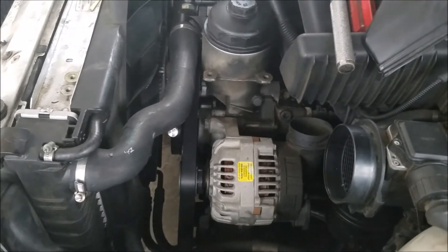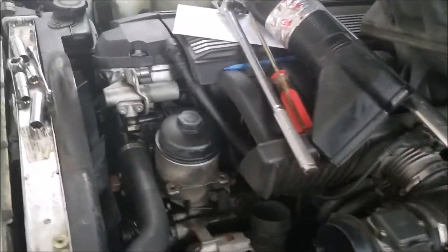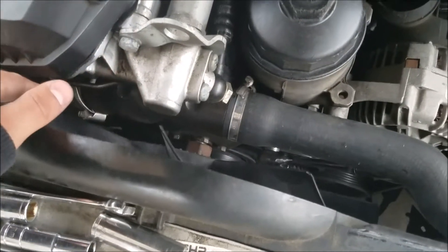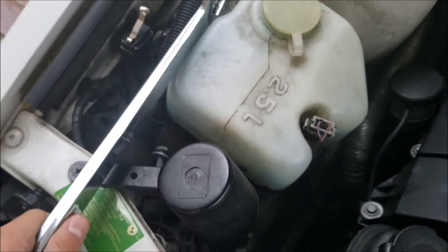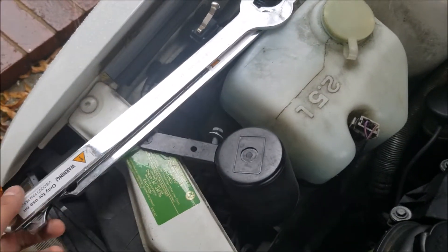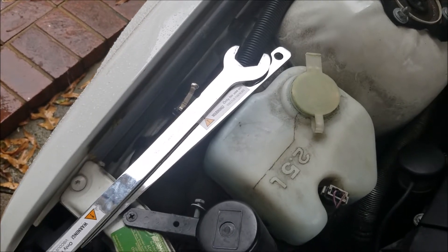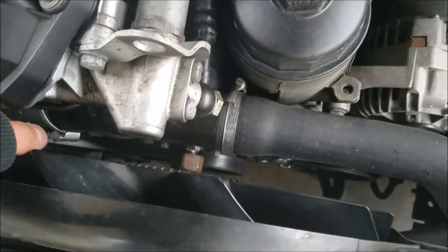The first thing you need to do for this job is remove the cruise control box and then the air box, which is really quick. After that, I like to get some extra room by removing the fan. It's really easy to do if you have the tool — luckily from a previous job rebuilding the coolant system I bought it. It's about 10 bucks on eBay and if you own BMWs you'll end up using it a couple more times.